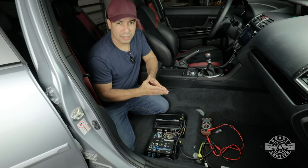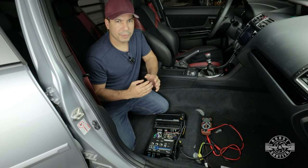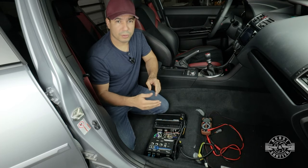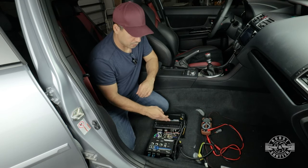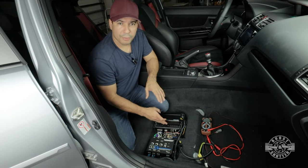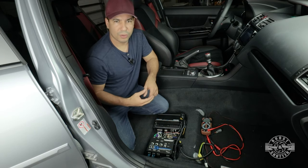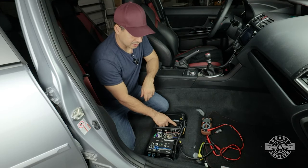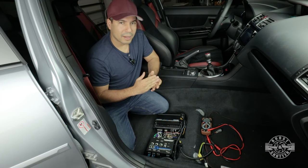Keep in mind that if you exceed the maximum input sensitivity of the amplifier, the amplifier will start clipping and distorting the signal. It's not going to make more power than what it's rated for — it's simply going to send a very crappy signal to your speakers, get hot, and probably damage the speakers or itself. So if I set the gain to give maximum power at 4 volts, I can never get the maximum out of it if my head unit is only feeding it 3 volts. But since I have the gain, I'm essentially telling the amplifier to make maximum power at 3 volts instead.